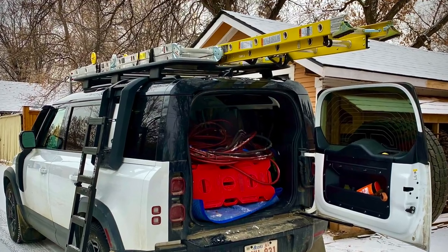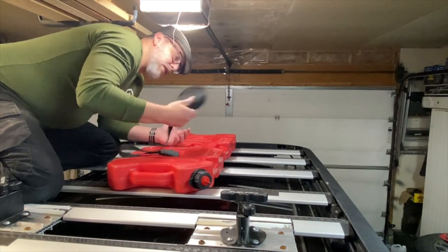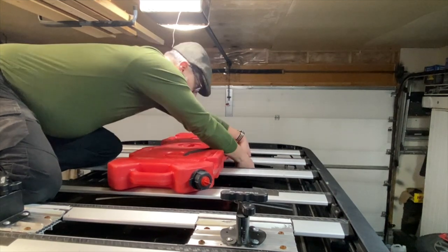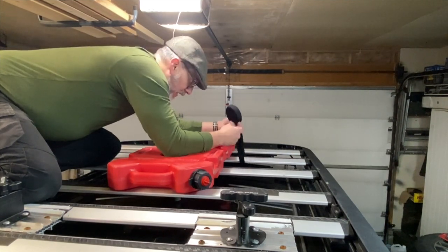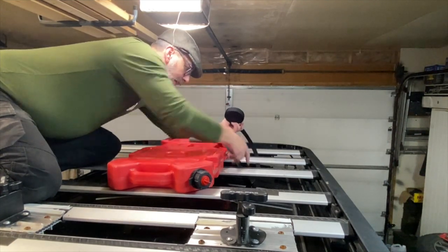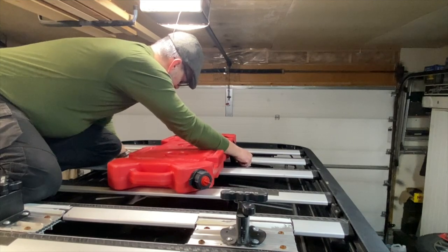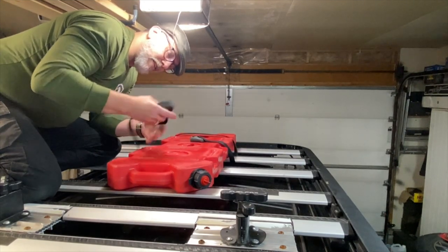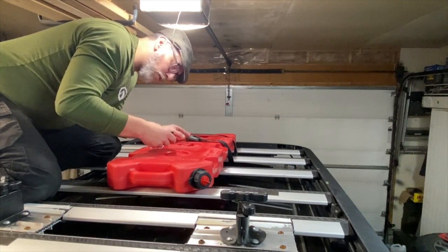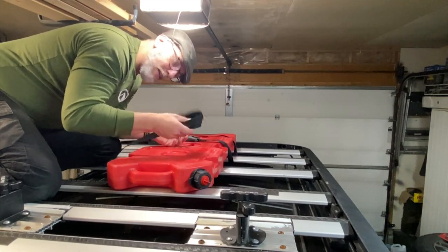So what I do, he says, trying not to bang his head, is I take the cam strap and put it underneath one of these straps, so you've got a kind of loop underneath, can you see? And then I leave this chap on the top, making sure that it's rolled up right, and then I'll cross this over the top again and underneath back here like this, and then you've got this end loop here. And this is why you should always roll them with this bit out, because you hold on to that, and then you can throw it over the roof, you see, because you've got a bit of weight about it.